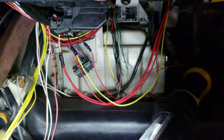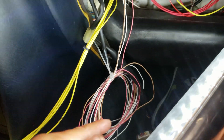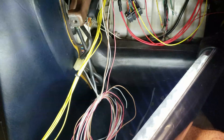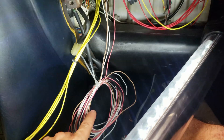I redeemed myself — went ahead and added the splice into the switch 12 volt. It's going to run out the stock location to feed the boost controller. Now I just need to run the pin out for the boost controller as well. Also in here I have two fuel pump outputs. Right now I just have the fuel pump on the key for the car, so once you switch it to the accessory position the fuel pump turns on. It's just a single fuel pump, so I'll save the second output for when I go dual fuel pump — the second pump will turn on on boost, controlled by the ECU.